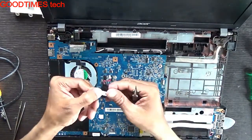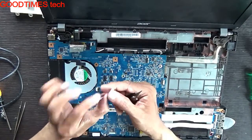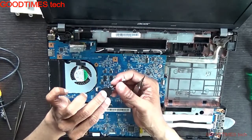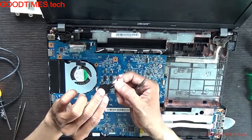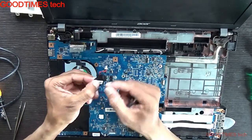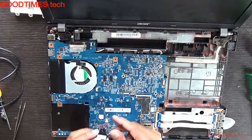So after taking the BIOS battery — the thin one — you can fix it. If you do not get the sealed one with the connector, you can take a CR2016 and connect two wires. Remove these wires from the old BIOS battery and fix them positive and negative. Stick them gently and thoroughly so that there should not be any loose connection.